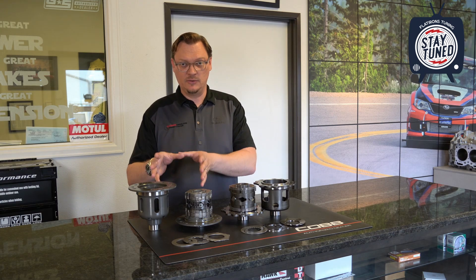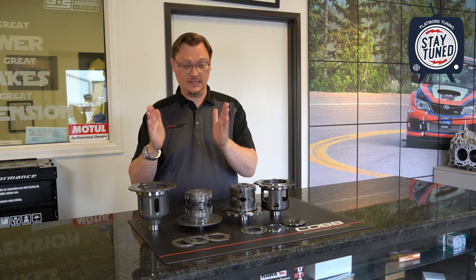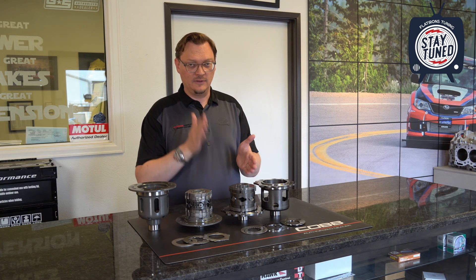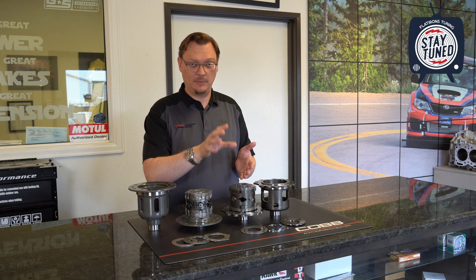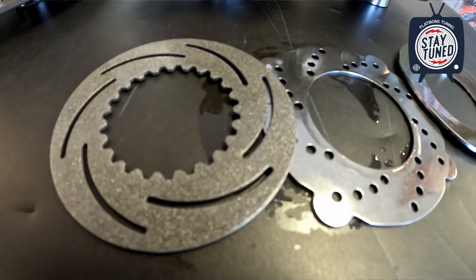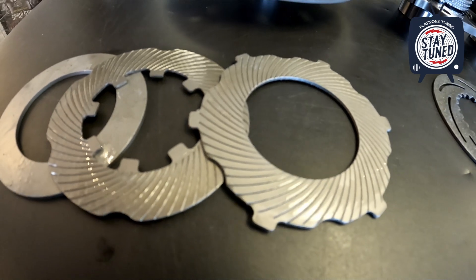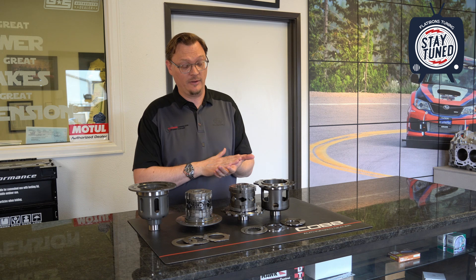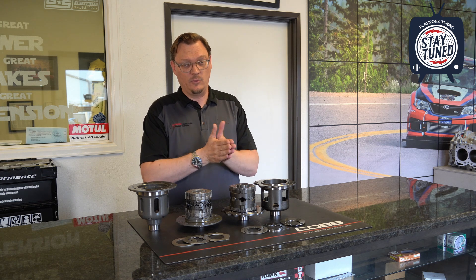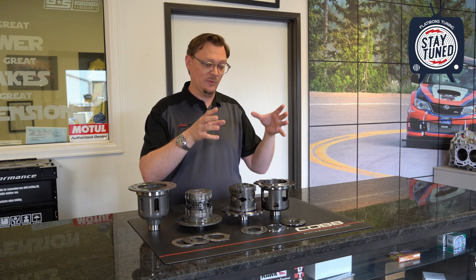Here's the analogy to think of when looking at the discs. The discs in the Cusco diff are like two brake rotors — where you get the lockup is by squeezing those two rotors together. It's very similar material, and visually they look basically the same. In the Mona diff, their unique proprietary thing is that they apply a friction material to the clutch discs. The Cusco discs have grooves for oiling but feel smooth — analogous to a slotted brake rotor. The Mona clutch discs are actually rough, like emery paper or light sandpaper, and their steels are smooth. So the analogy is applying a brake pad to a brake rotor — you get a lot more friction between the clutch disc and the steel in the Mona diff. That's the special sauce that sets apart the behavior between the Mona diff and the Cusco diff.